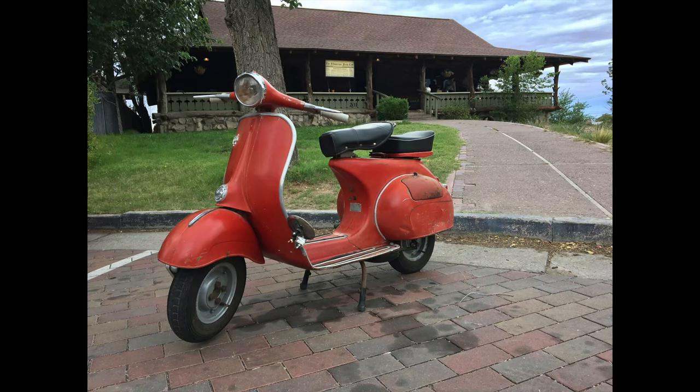And one of our other members, William, came a little late to the meeting in his Vespa, and we happened to have been tinkering around with an IBM Wheelwriter that one of the people brought, and the metal rod guides that the print mechanism slides back and forth on were really grungy, and we didn't really bring any solvents or any really adequate cleaning supplies. And so this is what you do at a typewriter meeting when you're a little bit unprepared: you get your friend that has the two-stroke Vespa, you give him a paper towel, and he goes out to the Vespa and dips the paper towel in the gasoline/two-stroke oil mixture, which we used to clean those guide rods for the print mechanism on the Wheelwriter.